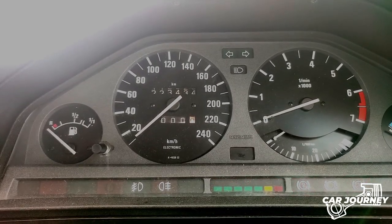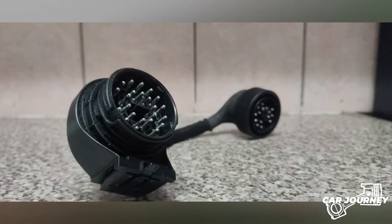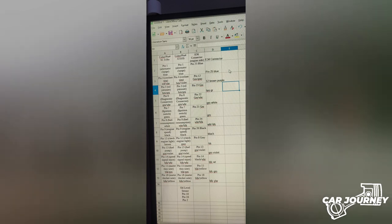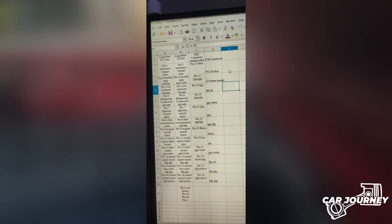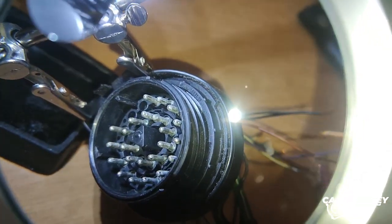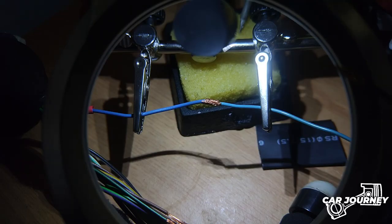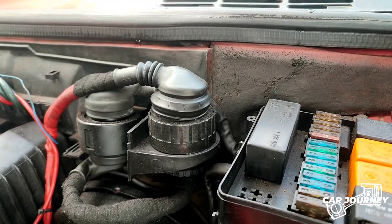Now there's one main question: how does the engine talk to the car? You'll need to make an adapter plug. I've made a pinout table from the wire colors of the two E30 C101 plugs versus the E34 one I have, to make sure my pinout is correct. Just to be safe, double-check your wire colors and the plug ends by sliding the rubber boots back to verify. With some shaky hands and a lot of coffee, I was able to solder my adapter plug. The C101 with the E34 harness — complete. It was plug and play. Well, kind of.